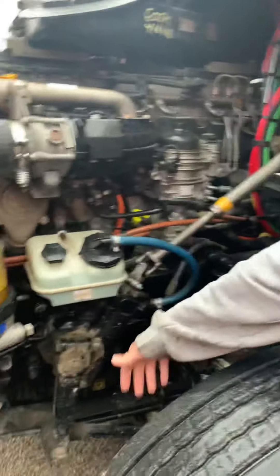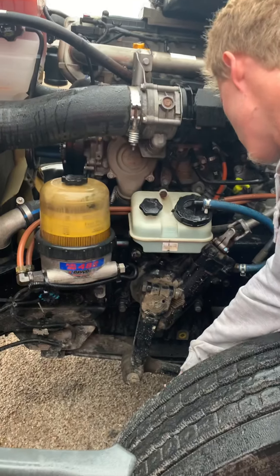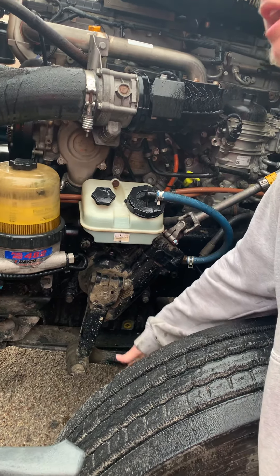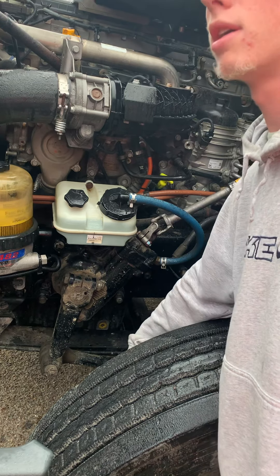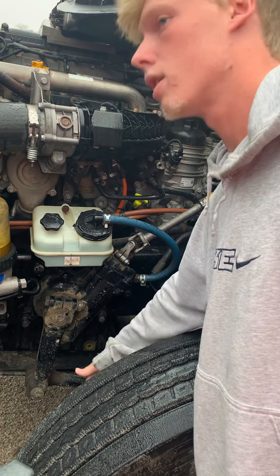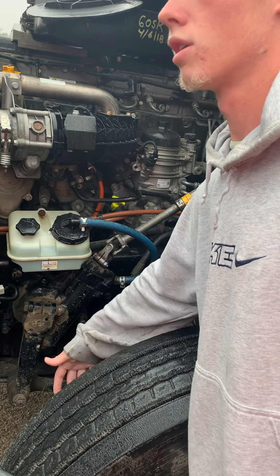I got my brake drum, properly mounted and secured — just point in toward the tire when you do that. Nothing been broken or cracked, and it's free of debris, grease, and oil. My brake pads are properly mounted and secured, nothing been broken or cracked, and they're free of debris, grease, and oil. And there's no less than a quarter inch of pad.